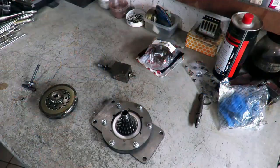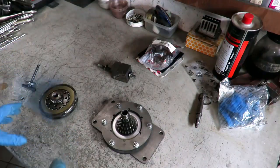I will also show you the preparation that must be made on the crankcase to accommodate the new components, namely the crankshaft and the thermal group. In fact, we should bore the crankcase on the flywheel side to house the shaft shoulder, which is larger in diameter than that of the crank chamber. And then we'll have to apply putty on the base to be able to connect the transfer ports in the best way. And let's start with the primary ratio.